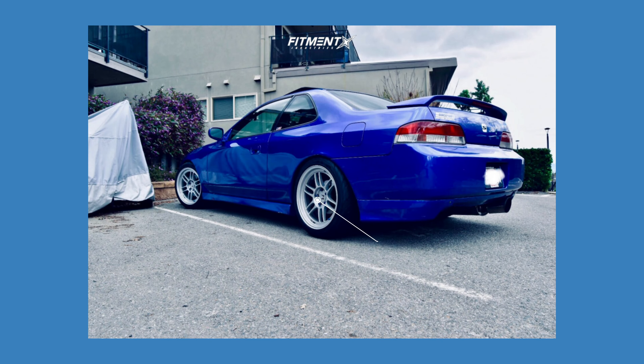Kicking up to a nine inch wide wheel, we'll take a look at another blue 2001. This time we're running some classic Enkei RPF1s — 17 by nine with a plus 35 offset, 235/45 for the size with a Federal 595 tire, sitting on some Function and Form coilovers. Getting a little bit more of a poke fitment here; a good size tire and a nine inch wide wheel really tend to fill up these wheel wells. There are some SPC camber bolts to help dial in camber, and there is still a slight rub at full turn even though fenders are rolled and fender liners have been modified. Overall, an aggressive wheel and tire setup that this car pulls off pretty damn well.